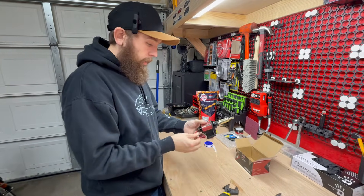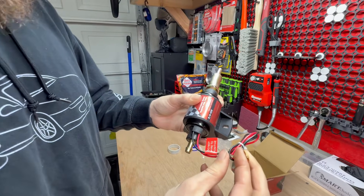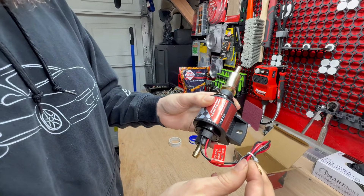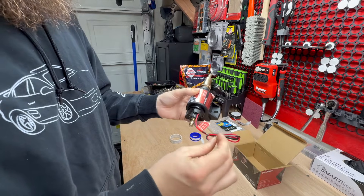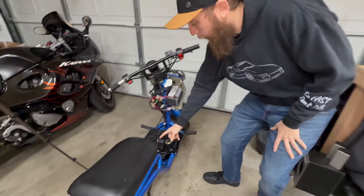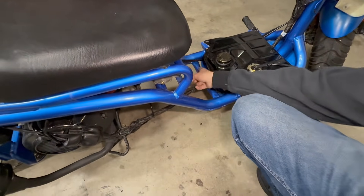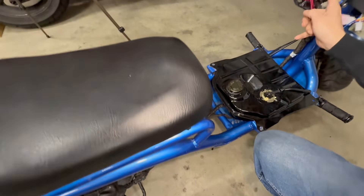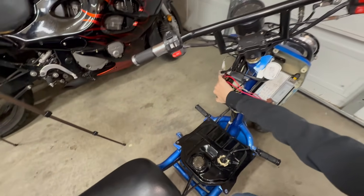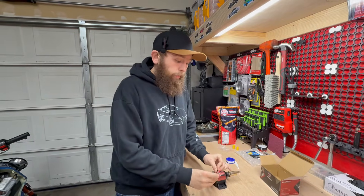The next step will be to actually extend this power wire. This power wire is going to need to go up to a constant power once your key is on. To be safe, I'm probably going to extend it about 3-4 feet. I'm going to route mine up under the battery — from here, under the battery and up into the bundle. I don't think I'm going to go right to the battery; I'll find somewhere in there. I'll get that done off camera.